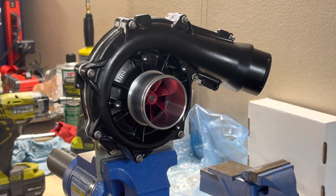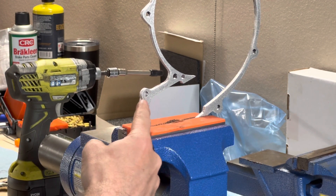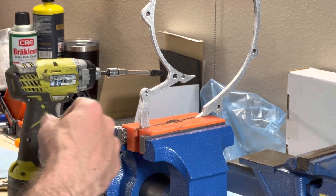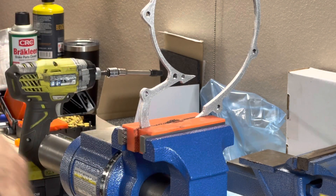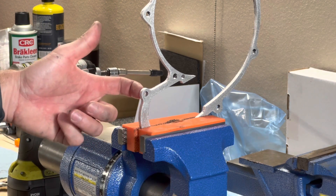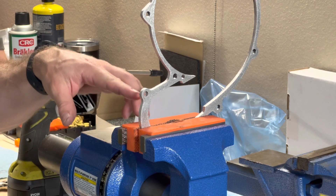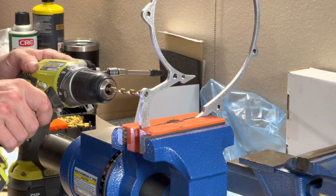What I found was that on bolt number nine, the hole on this plate was not lining up correctly. As the bolt started to go in, it wasn't making contact with the threads it needed to. So I had to pull everything back off, clean the plate and mating surfaces back off. I'm going to step up the drill bit and make the hole slightly bigger. You can see in here where the threads were making contact with the plate instead of going into the supercharger. I'm just going to drill that out.